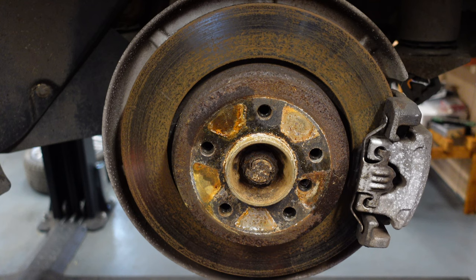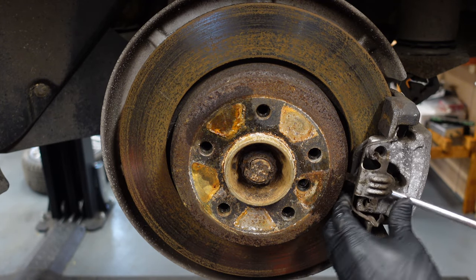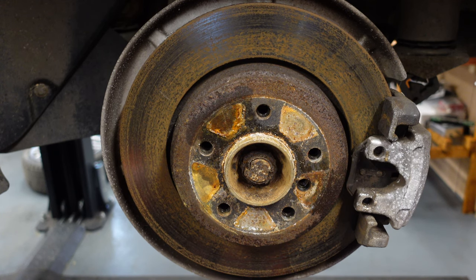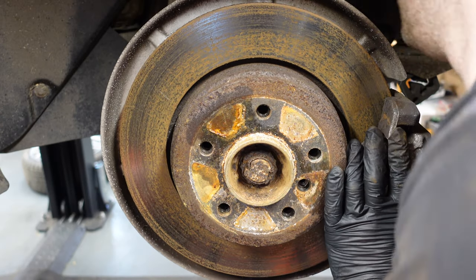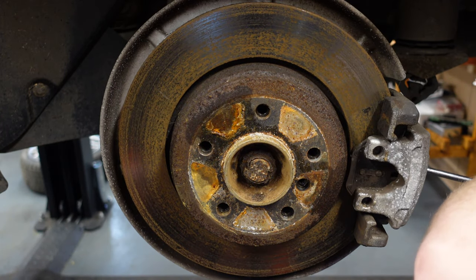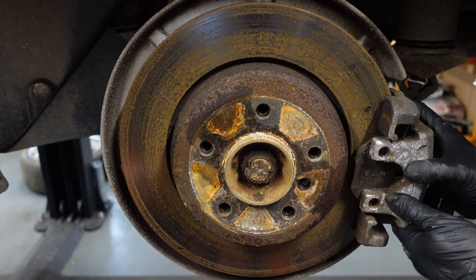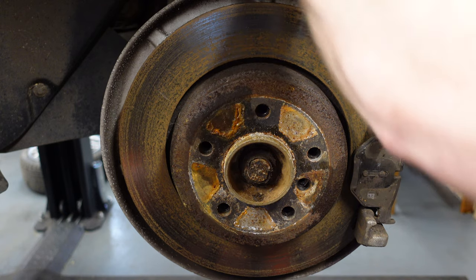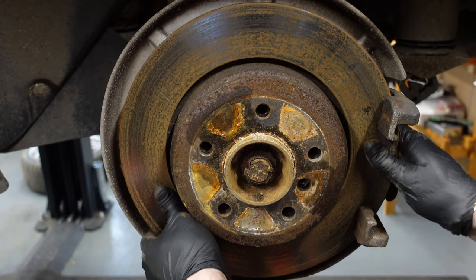So now we're on the rear side. The rears are much easier than the fronts. We're just going to take this holding clip bracket off — it can be a bit stiff because of all the debris off the road and rust. Now we'll go ahead and release the bolts — very simple to do, same size as the front, just drop them out. Then push something in the middle to break them free and the caliper should come out. Very simply unhook the old brake pad. Put your carrier up there and take the old brake pads out. I've already got the disc bolt off.